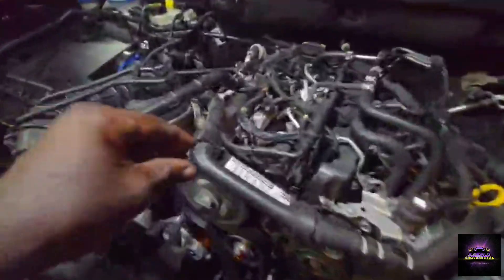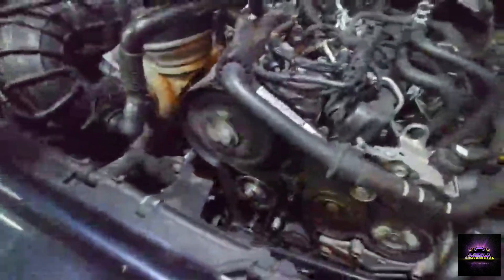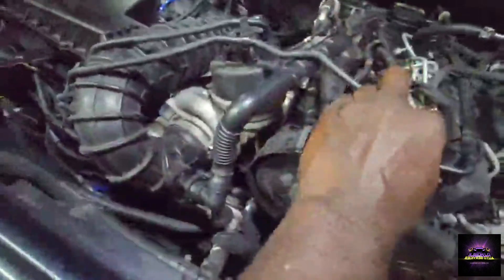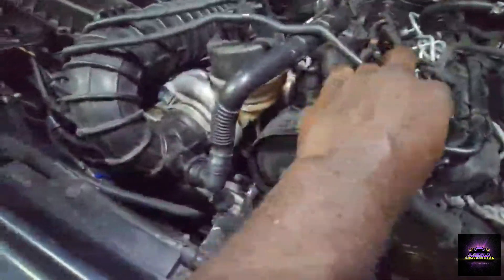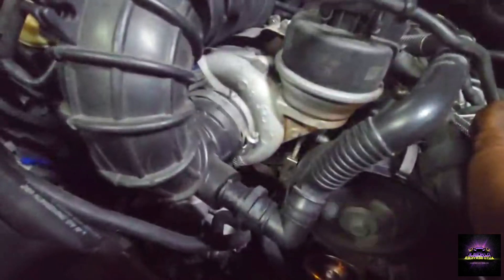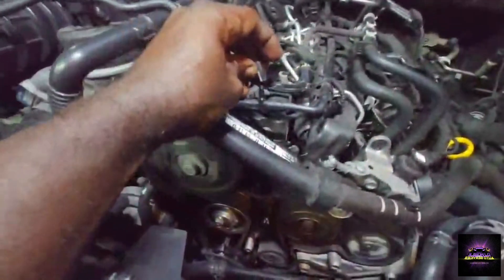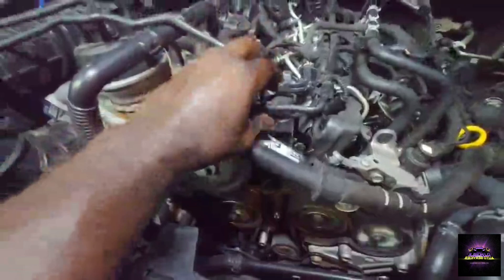I'm not developing much vacuum at all. So if I'm suffering from vacuum, that means the turbo actuator can't get what it needs to actuate. So what I'm seeing here — the actuator shaft is moving, as you can see, but for some reason we have a performance fault. I don't believe we have a circuit problem, like something's wrong with the actuator.